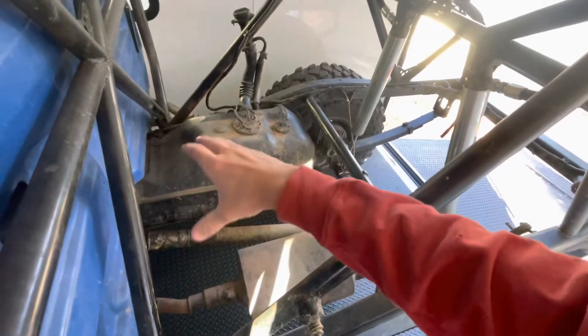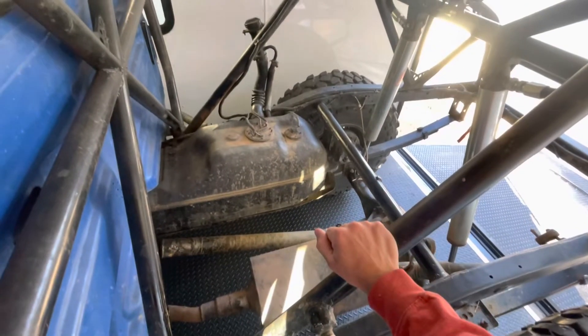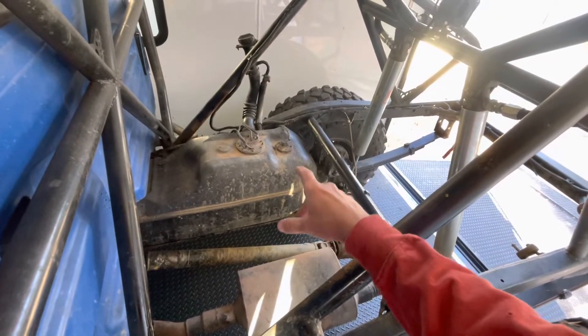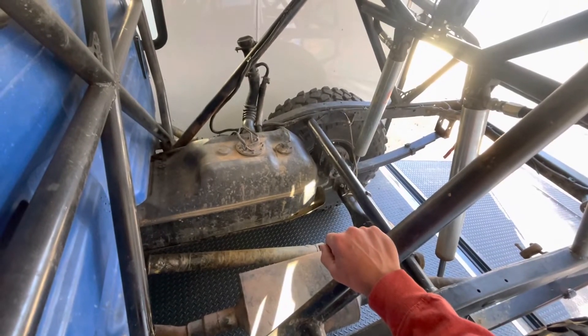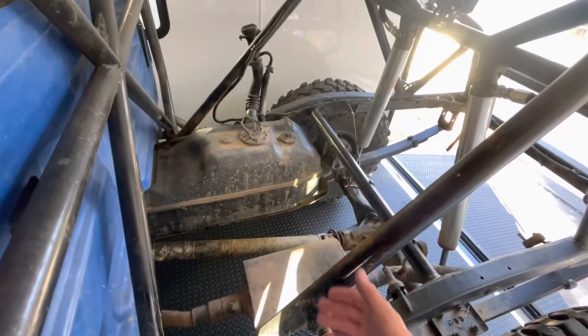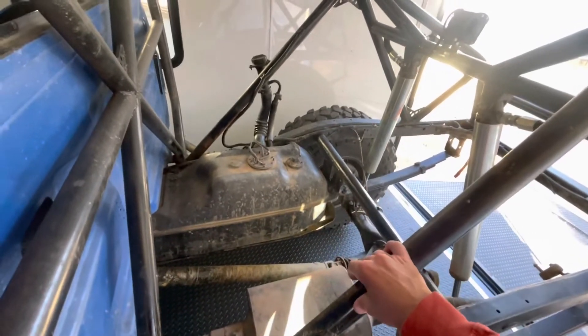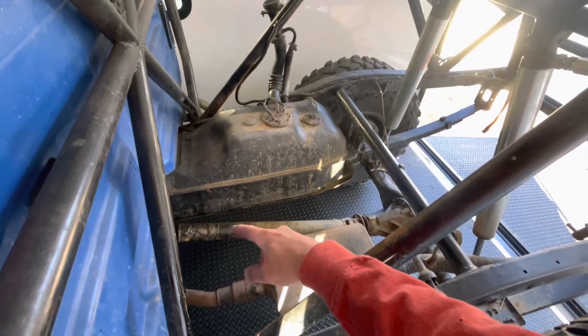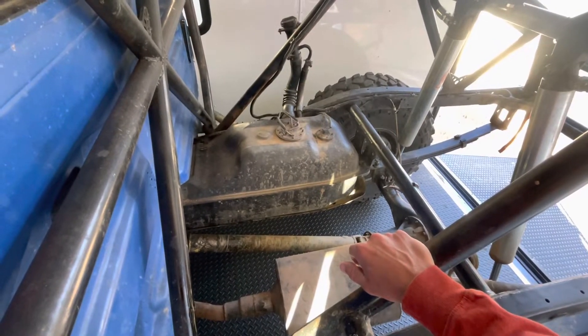I'm going to have my fuel tank behind the cab. The factory tank looks fine from the top, but from the bottom it's all bashed in from rock crawling. The fuel sender, the pump sending unit, the pickup tube — everything must be damaged because I have problems picking up fuel on any kind of incline, and I never used to before. If the tank's not all the way full, I pull up on an obstacle and the truck will stall out. That's a new problem. The last time I bashed the tank in, it was actually hitting the driveshaft — I bashed it back out of the way with a hammer on the trail.